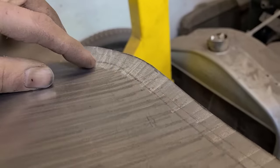This doesn't work out so well on newer vehicles, because on newer vehicles the inner structure is usually 2 or 3 or 4 or 20 layers all welded together. So, you know, on that stuff, it's easier just to do your holes from the outside as you conventionally would. But on this older stuff, it's usually just a single layer. So just saves you a bit of grinding and messing around. So it's just something I like to do.